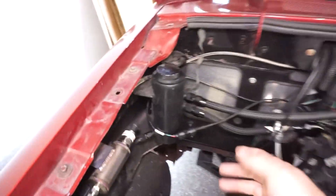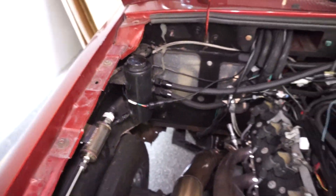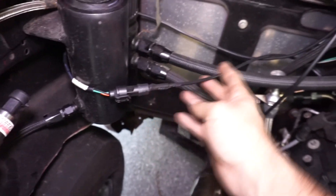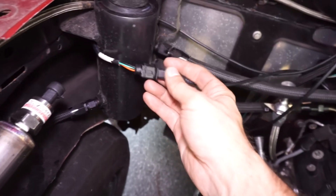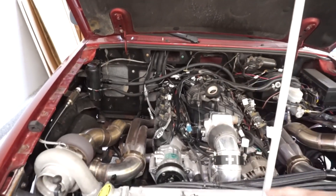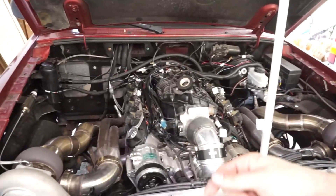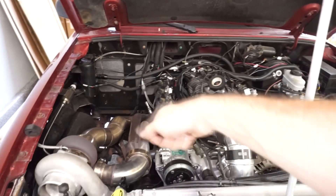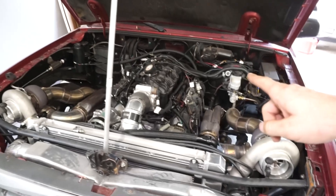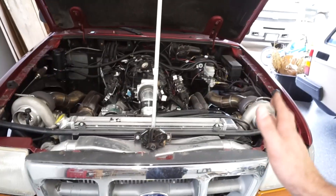I made a sensor extension so I could pull off of my back pressure sensor wiring without having to change any wiring. I got a connector and just pinned it onto the end of that cable, so now I can use my back pressure wiring with the sensor extension and set it up in the ECU. This cable is also about 15 feet long, so if I wanted to add a sensor anywhere in the vehicle I could just steal that and hook one up for testing - I do plan to add transmission pressure so I might use it for that.